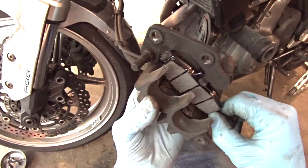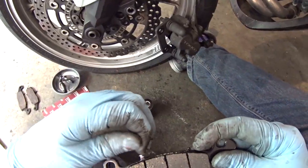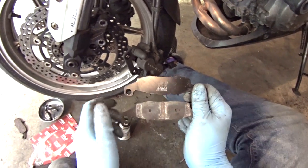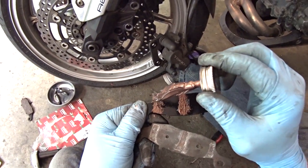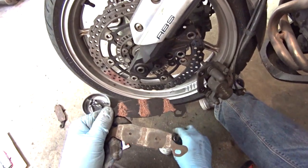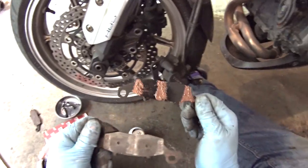Just slide the pad in there - slips into place. Be careful not to touch the surface of the brake pad now because I've possibly got grease on my fingers. So that's that one in. Now with the inside one, it only actually contacts here, here and here and the rest of the pad is left open, so we just need to put the copper grease in these points. You can actually get sticky pads which go on the back of the brake pads which are apparently more effective than just copper grease - they cost a lot more, about five or six euros for a set. I did read lots of reviews saying that they affected the feel of the brakes because they essentially make an actual physical cushion between the pads and the pistons. But I'm going to go with the old traditional tried and tested much-loved copper grease option, and if that does still make some noise maybe I'll get some pads and slip them in before the trip starts.